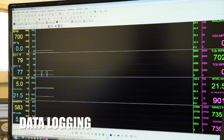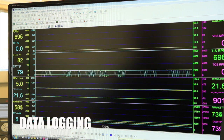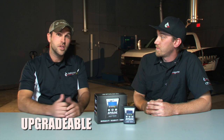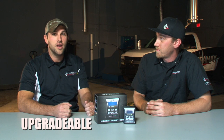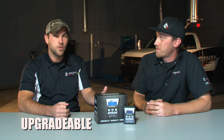You can take that data log and with the USB cable you can email it to us. We can look it over and say hey, you either have a problem or we need to make an adjustment in the tune. The Spade is fully upgradable — you can send us an email or call us on the phone, we can take that USB cord, plug it into the Spade, get that data log off, build new tunes for you, email them to you, and you can load them on there.